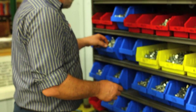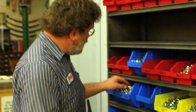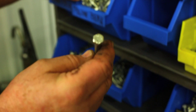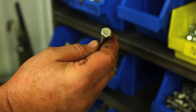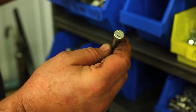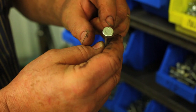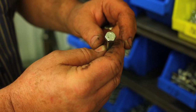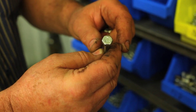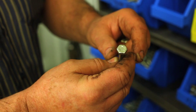If we take a look over here in my 5/16ths — come on in closer. So here's a British bolt, because you can see that it's got the circle, and it's still got the three hash marks on the outside. See the one, two, three hash marks on the outside? That lets you know that it's a grade 5, because they're always grade 2 to start with, and then each hash mark adds a grade to it.